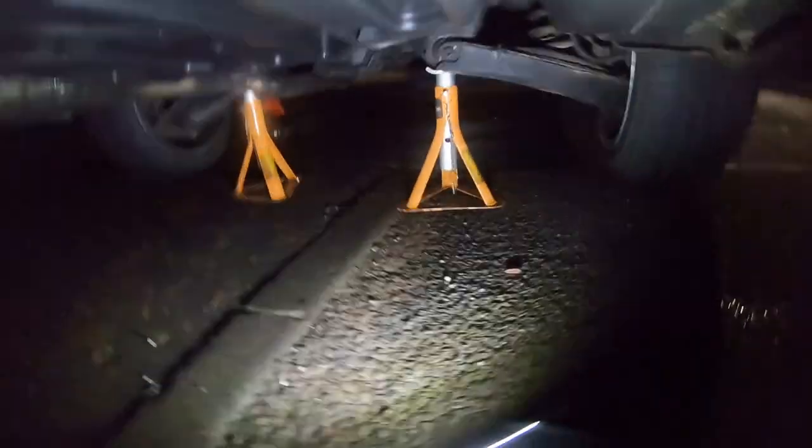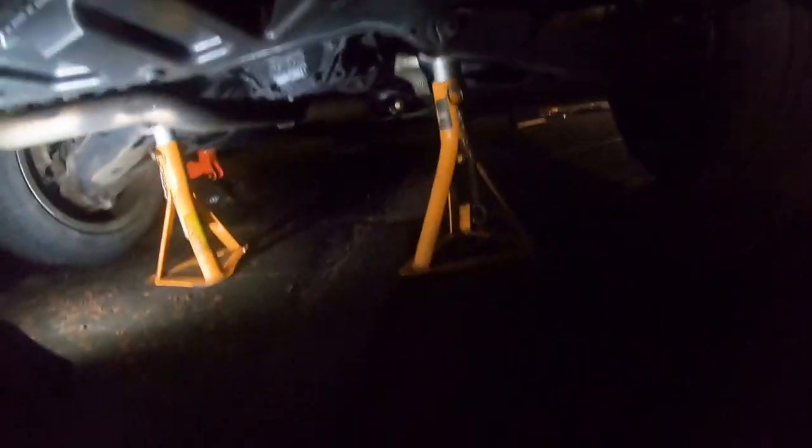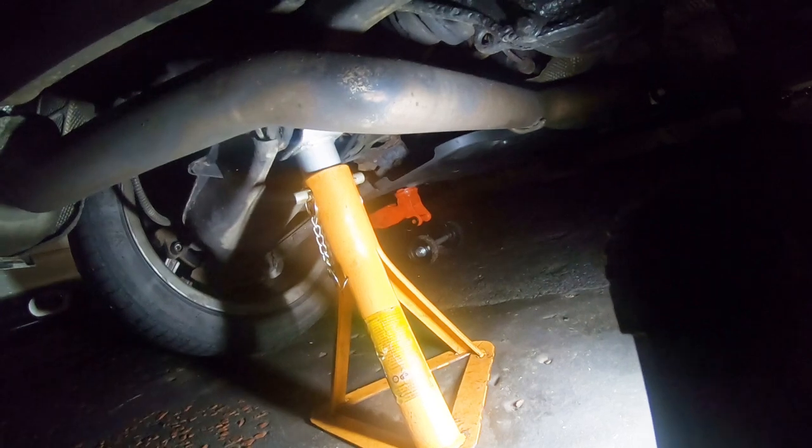Now I've got the rear end jacked up on an axle stand, so I do the push test — that's not going anywhere. The wheels are virtually touching the ground, which should give us enough room to get under and have a look. At first it seems alright, but the problem is there — you can see some corrosion. You can see where the mount's broken off. Let me bring the camera a bit closer and get the light. You can see the mount's actually broken off, but the rest of the subframe seems to be in decent shape.